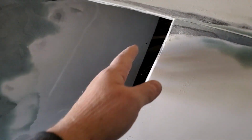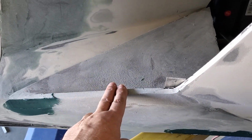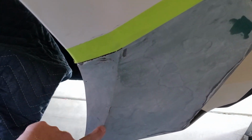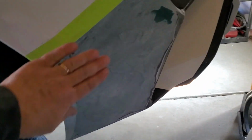Okay, back in here, we've done the kind of Frenching in of these little trim vents on here, and shaped up some of the profiles and filled in some of the holes and whatnot. So those still got to get sanded. We've made our cut along here, so that when I break these two panels apart, there'll actually be a seam line that'll run straight down here. And then I'll further develop this line here, so it'll come down to a point and then arc back in, like you see it is right now, but it'll fit really well with this kind of flat part of the quarter panel, and then just transition down. And I think it's turned out really nice. It's still got to be block sanded, but it's getting there.